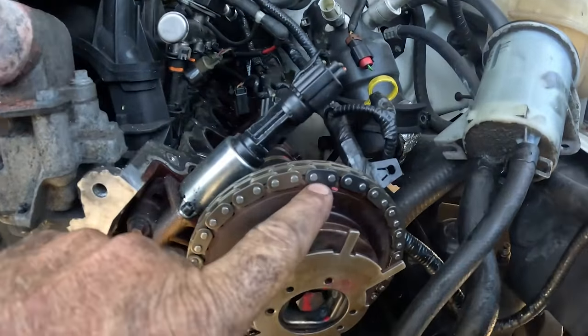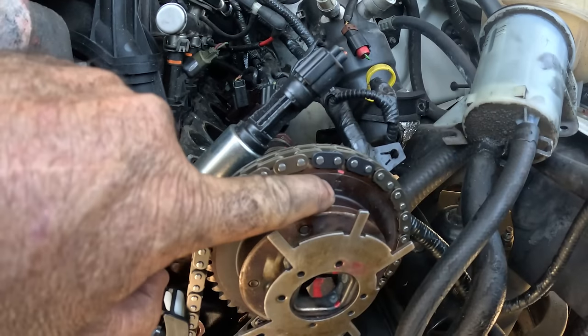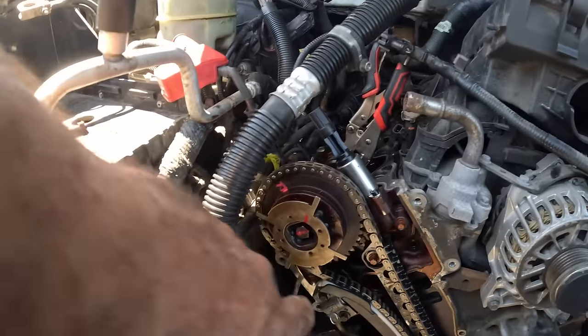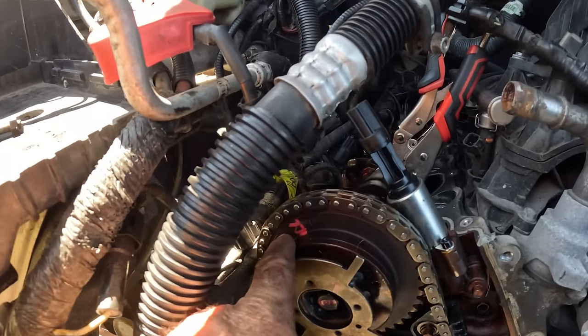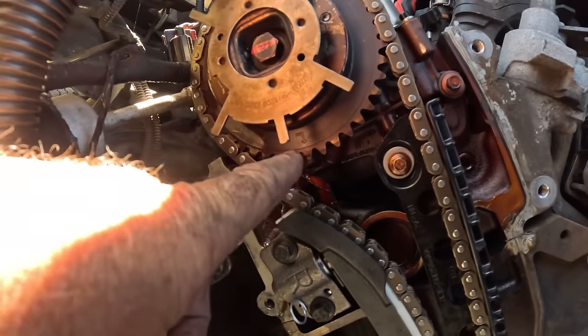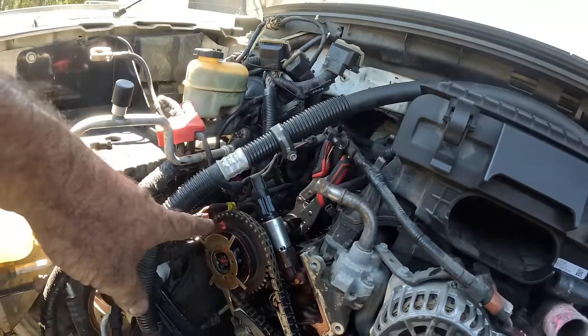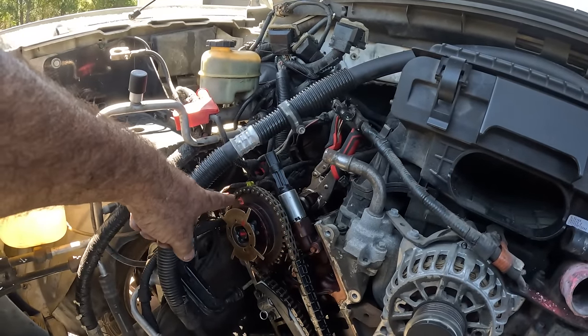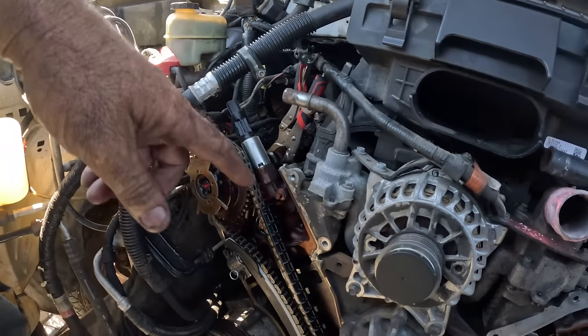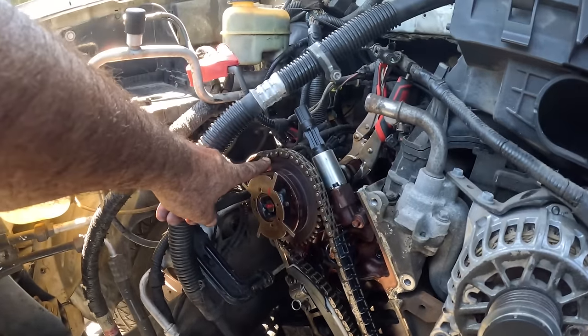Now, you'll see the two colored links up here and the L. Well, it's the same on the other side, except in reverse. I've painted a little R there, but there's a locator dot there and the L's down here. Some of the phasers will actually have an R there, and that's why I've given myself the cheat sheet and just put the R there in case. And then you just line those two colored links up